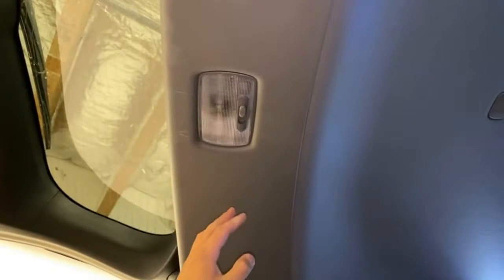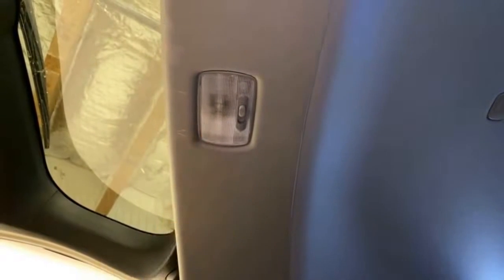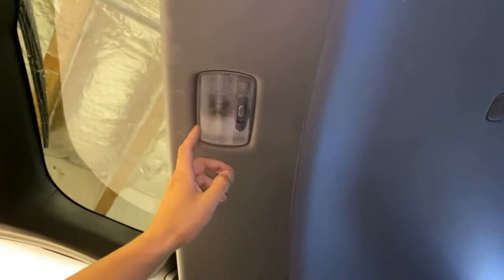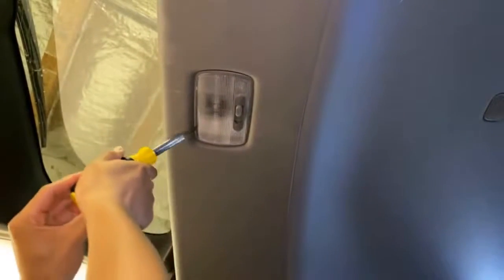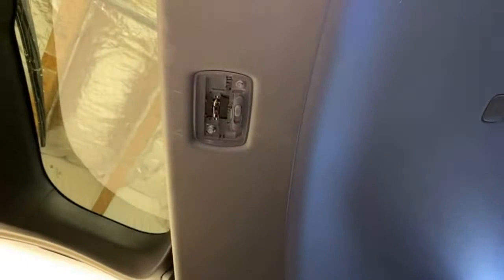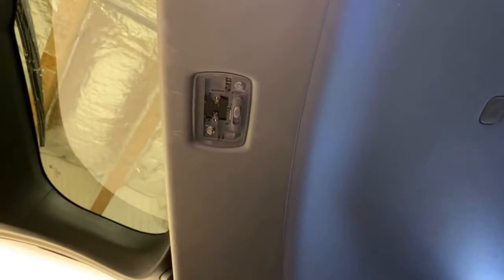When swapping out the bulbs, make sure the light position is in the off position. To remove this plastic covering, what you're going to do is take a flathead screwdriver, locate the 2 indents, stick the screwdriver in, push down, and push down. The plastic cover should come off pretty easily. If your light has been on for a while, be careful when removing the light as it may be pretty hot. Simply just pull the bulb out